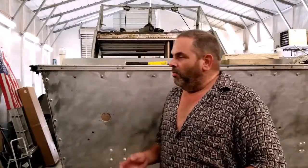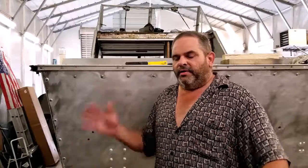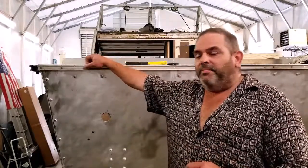That's going to do it for this episode of stripping the boat of all its old tired paint. We'll get this finished up over the next few days. One thing I do want to mention: you can't do this in extreme temperatures. Right now it's extremely hot in Michigan — when it's getting over 80 degrees and I'm trying to apply the stripper, it tends to want to dry out before I can get the complete section done. So I'm doing this in the early morning and evening, out of the heat of the day. That probably goes for extremely cold temperatures too, which would likely have a detrimental effect on the reaction with the paint.